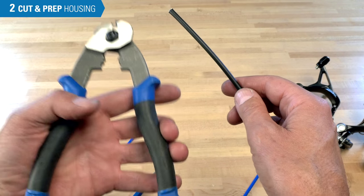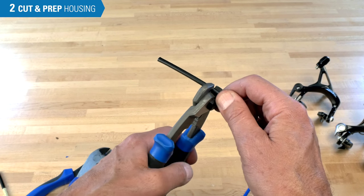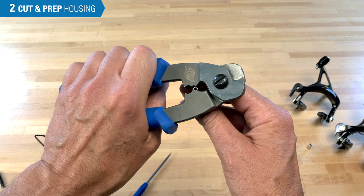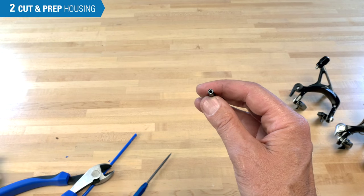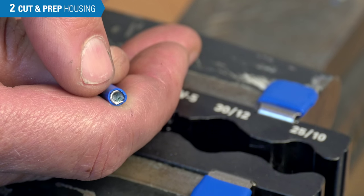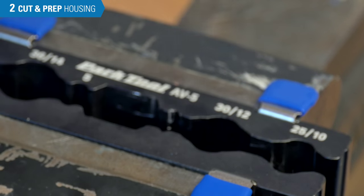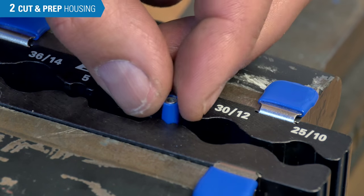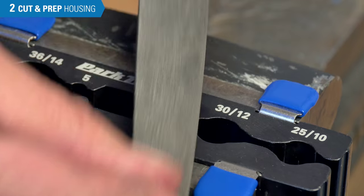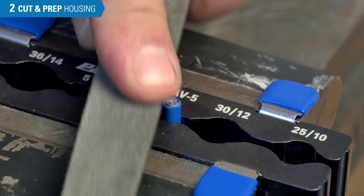The braided or woven housing does use the cable cutter. The construction here is of multiple wires inside. Find where you want to cut, hold the housing square to the tool, squeeze, and it cuts. You may find that you've ovalized it a little bit — use the little crimpers on the tool to open that up. Repeat with the seal pick if necessary to open up the inner liner. Sometimes there's a jagged end or burr that trimming simply can't remove. You can file it out by hand, or use the axle vise with a five-millimeter, have the housing barely stick up, gently snug it down, then come across with a file to trim the burr and make a nice, level, smooth, flat end on the wound housing.